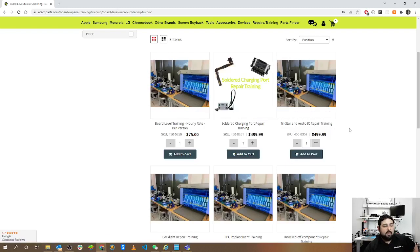TriStar and audio IC repair training. This one can be summed up as just an IC replacement. TriStar is the most common one we see from the customer where the charging circuit is damaged and replacing the charging port, replacing the battery doesn't fix it. TriStar is usually the cause. So this training shows you how to replace that IC as well as the audio IC, which is common on the 7 and 7 Plus. Again, another common manufacturer defect that we've seen over the years.